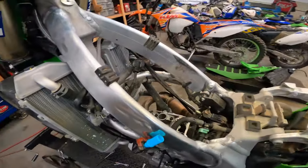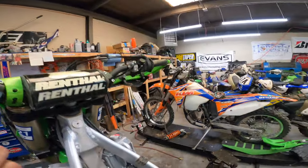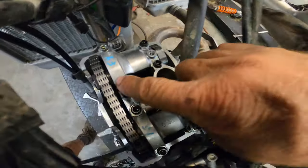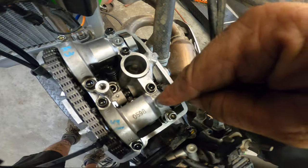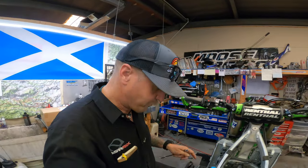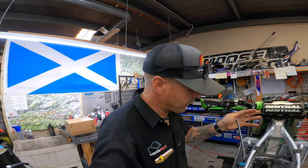All right, guys, it's time to tighten up the cam caps. Obviously, torque wrench, highly important for this situation. The other thing that's pretty important is, it's pretty hard to see again on this camera, but right here, there's a one, and then there's a two and three, even down to eight. So that is the order you're supposed to tighten it in. So it's nice. It gives you numbers to follow. It's really simple. Otherwise, you just do kind of a crisscross pattern and make sure you don't tighten one side more than the other. But it is nice that they put that on there.